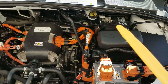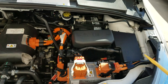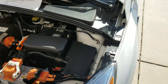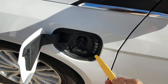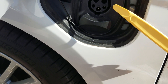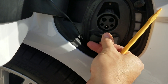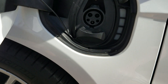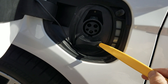So what happens when you run out of battery? The same as in an internal combustion engine when you run out of fuel — you have to refuel. These cars can refuel through the charging ports here. There's a standard J1772 connector. These can be level one or level two. This car also has a DC fast-charge option. You can use one or the other, but not both at the same time. The most common way is to charge with AC power — AC is on one port, DC on the other.